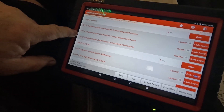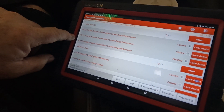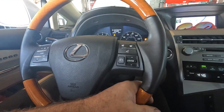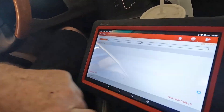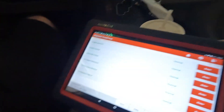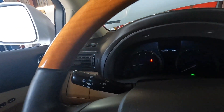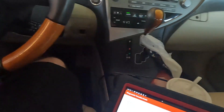Apparently code P2118 — when they jump-started it — is exactly what sets when that fuse blows. It also has an oil maintenance required light on there, but we changed the oil and it's not due for another 1,500 miles, so I'll reset that. Clearing the DTCs now — there go all my lights. Boom, that was quick! Battery is charging fully, and I'm going to set the headlights to automatic instead of on.